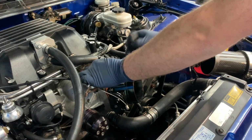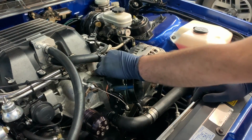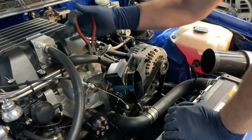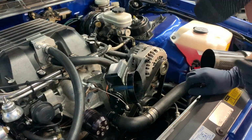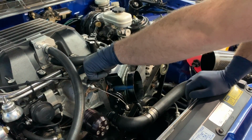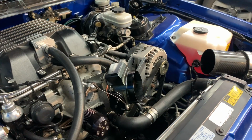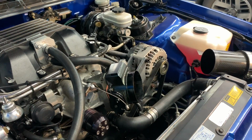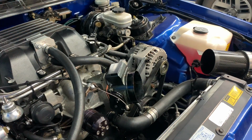Brake booster hose. And then I gotta come in here and undo one of these lid bolts, because the one lid bolt right under here just extends out of the casing, and the snout gets hooked on it sometimes when you're trying to pull it out.